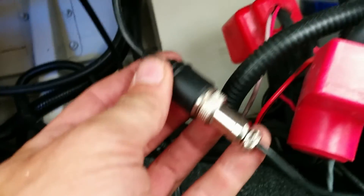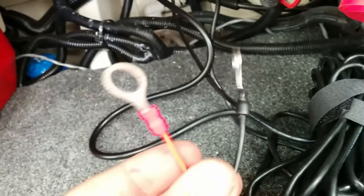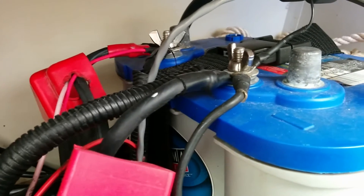The box is mounted. On this connector here I've attached the transducer and just coiled up the rest of the cable. I then have my red and black power wire for the box to connect up to the positive and negative terminal on my battery. Then I can just tidy up these cables, pair up to my phone, and I'm done.